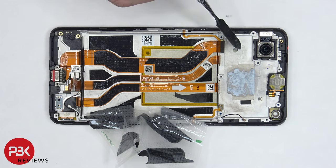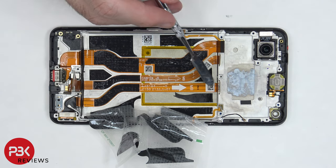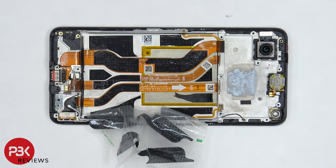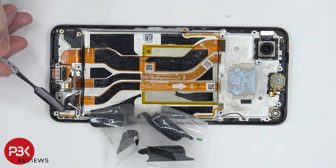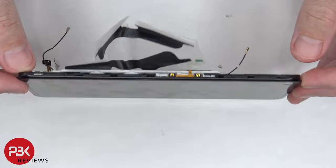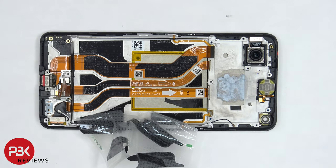This flex cable connects the charger port to the main board. This one connects the main board to the sub board, and this one connects the screen to the main board. So if you need to replace your screen, you would have to take the back plate off, remove the screws and the back housing, and then remove the sub board on the bottom, which will give you access to the screen cable. You'd be able to disconnect the screen cable, then heat up the front of the phone to loosen up the adhesive, pry your old screen off, apply new adhesive, and reapply the new screen and reassemble the phone.